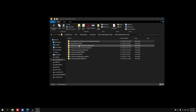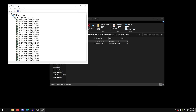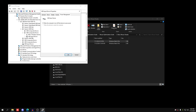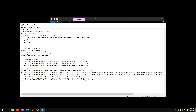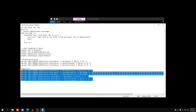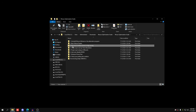Now go to the second folder in the Mouse Optimization Guide for basic mouse tweaks. The first is 'Disable Driver Power Saving' — in Device Manager, USB devices have a power management setting that allows the computer to turn off the device to save power. Running this bat file disables that for everything connected via USB. The second is 'Mouse Tweaks,' which includes BCD edit timer tweaks, disabling mouse acceleration via registry, and the MarkC mouse fix.